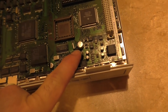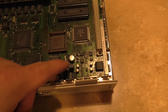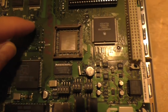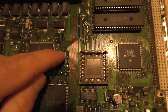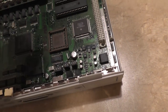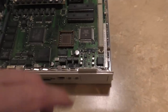I had a pad tear off, so I looked at the situation and thought it over, and I realized that the best solution in this case was to tear off the other pad and resituate the capacitor so that it soldered directly to these little posts that actually go through the board. They go from one side all the way down to the other, so they're pretty secure. So I soldered the cap to the posts. All I had to do was rotate it almost completely around, but it works. Everything on this machine is working right now, so that's what I did.